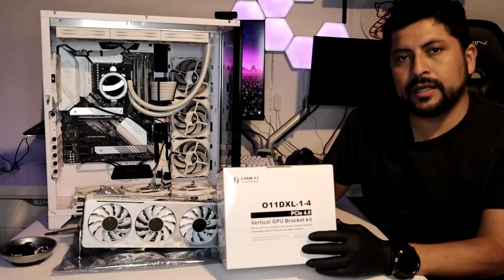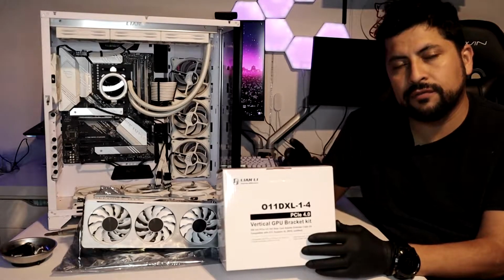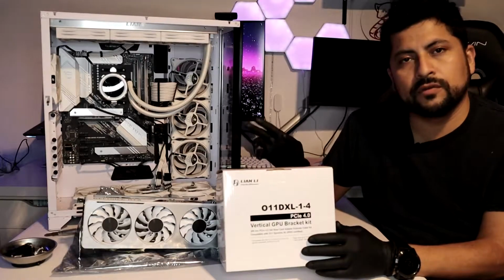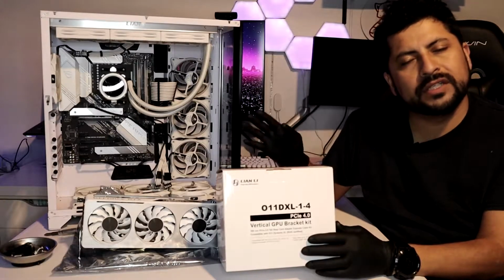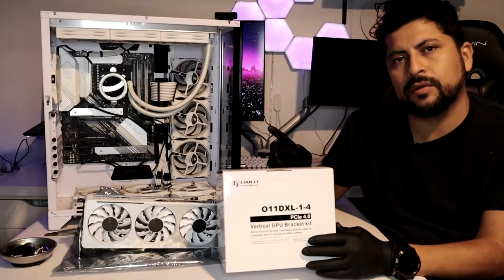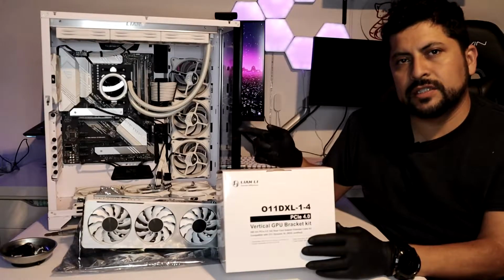And we did go ahead and bite the bullet with the price because it does come with the PCIe 4 Gen 4 riser. So if we ever decide to change motherboards and move the GPU and the vertical mount to another motherboard, we'll have full PCIe 4 support. So that's why we went ahead with this. Anytime you get a vertical mount and you're going to buy the riser, that's the cable that goes from the GPU to the motherboard, make sure it's PCIe 4.